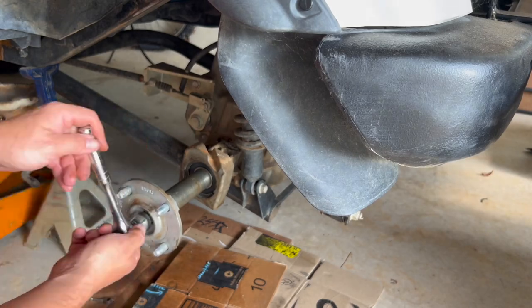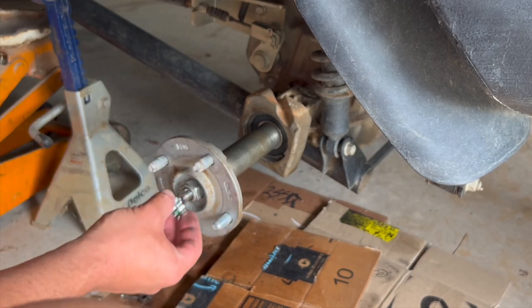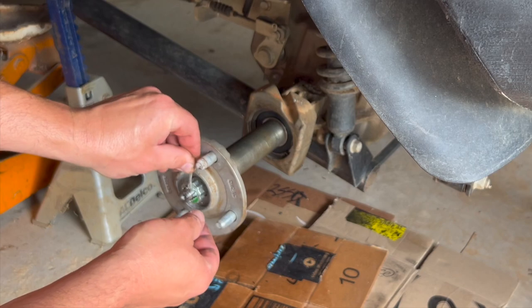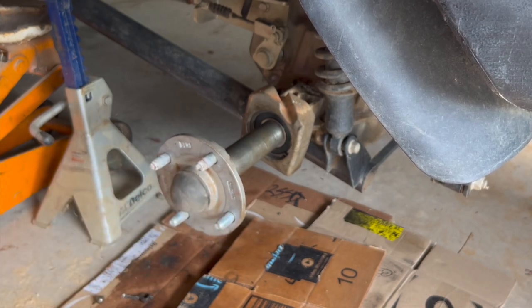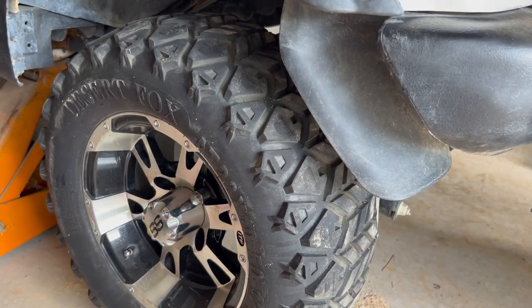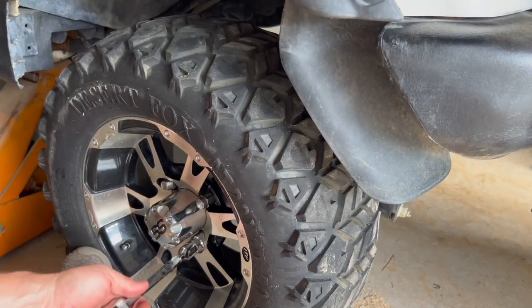The next step is to put the nut back on — the beveled side goes in. Put that on there, this little cover goes over it, and then this cotter pin goes in the hole. Got it all the way through and I'm going to bend it around. Now this little cap goes over it, which keeps all the dirt and grime out of there. And now we're ready to mount our wheel back on it. When reinstalling the wheel, make sure you work with posts that are opposite sides from each other and tighten them down a little bit at a time — don't fully tighten one before you tighten the others.